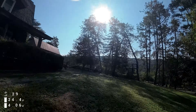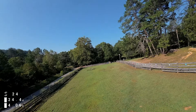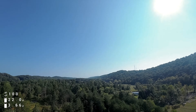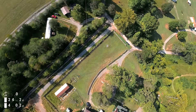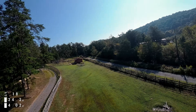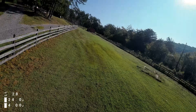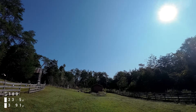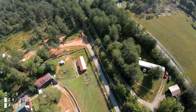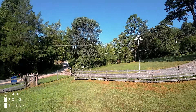So what we've got here is a fully charged lithium polymer battery — don't mind that it's reading 4.0 volts, that's because it's under load. We're going to do a full throttle punch out. And did you see that it dropped basically to 3.6 volts? We really got up there. It's holding at 3.6 and it is really getting up there. I'm really holding that full throttle punch so you guys can see the effect on the battery.